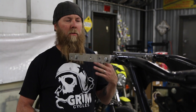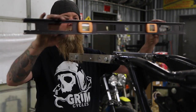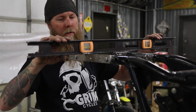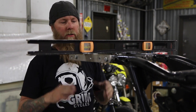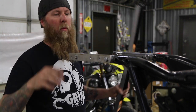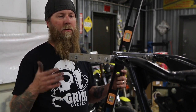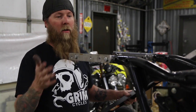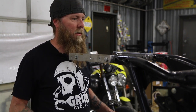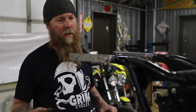Got everything set up for welding — I'm just going to double check everything, because once this is tacked on you don't want to have to make adjustments. Lay the level across here and do a check. We're pretty close. The measurement back here is eight and a half inches. I'm going to go ahead and put a couple of tacks on and check everything again — welding can pull and tweak things. If you know how to weld you should know that already. I would recommend that if you don't, have somebody who does know how to weld do this. You can get it all set up to this point and take it to somebody. We recommend TIG welding. From there, tack everything, do a couple more checks, and then you can go to town and get it all welded in.